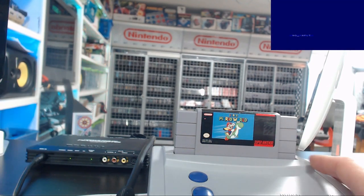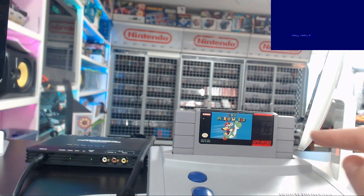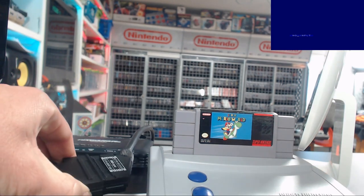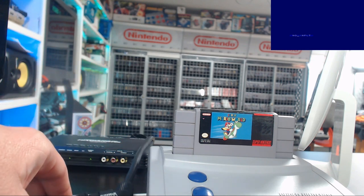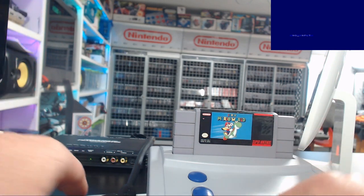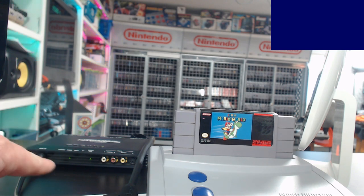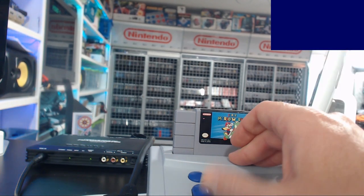I've got us set up to test. We've got our SNES 101 refurbished with the new capacitors from Console 5, replaced 7805 voltage regulator, and Voltar's RGB bypass mod board installed. I'm running this through some SCART cables custom made by Retro Access — I'll leave links in the description. Coming out of our SNES 101 through the custom cables into the adapter for RGBN for the XRGB Mini Framemeister upscaler, and then out of there HDMI into my Elgato capture card.